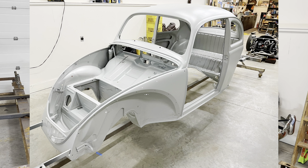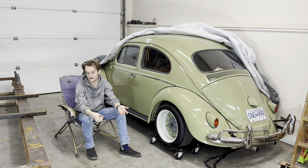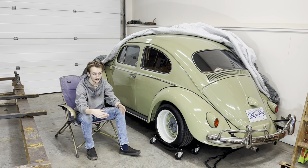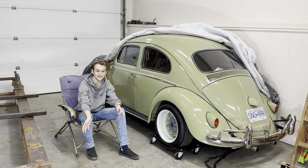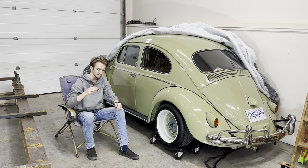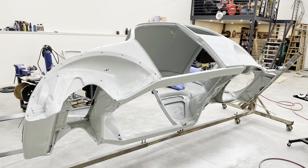When we got it back it looked great, but there was orange peel — that slight wave you can see in paint after it goes on. Before getting into this stage I had never used bondo, never done sanding primer, and had never wet sanded after painting with an air gun. Anyways, that wave had to come out, so we had to sand the entire car. The paint was really hard — it wouldn't smooth out very easily.